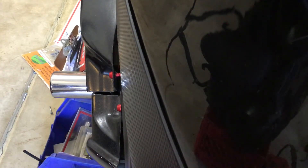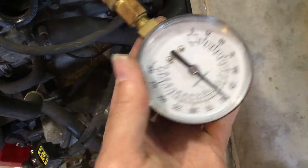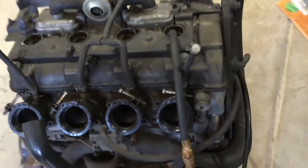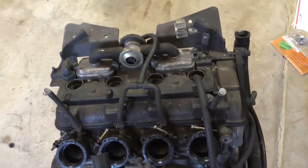So we're going to do cylinder four. We'll do the compression check. We're about 150 on cylinder number four. And like I said, there's a little bit of air escaping through the way the cylinder head and the spark plugs are designed for this engine.